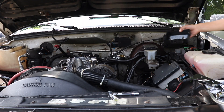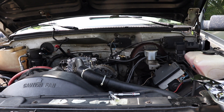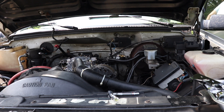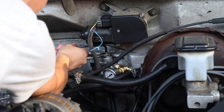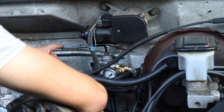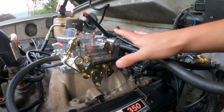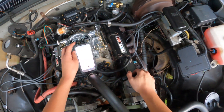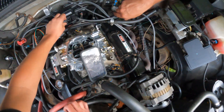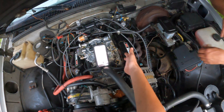This is the moment we've been waiting for — we're not starting it yet, but we are going to check for fuel leaks. There are no visible fuel leaks, but I'll double and triple check because we do not want any gasoline leaking out anywhere. The throttle cable bracket is mounted and everything looks fine. With everything run, we can now hook up the spark plug wires, starting with number one. With the spark plug wires hooked up, we begin zip-tying them so they don't rub on the exhaust.